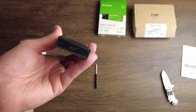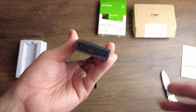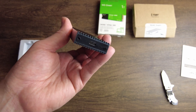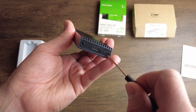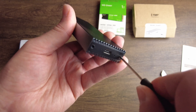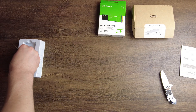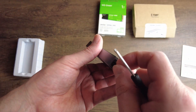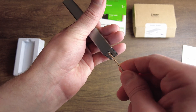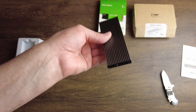The two different types of screws are black and smaller, which should tell you these go on the enclosure. Your enclosure will probably come with excess parts. Mine came with a separate set of screws for each section and another brass spacer — make sure you don't put that spacer underneath the SSD. That gap will be too large and could damage it. The groove is where it sits in between. These don't have to be overly tight, just snug.